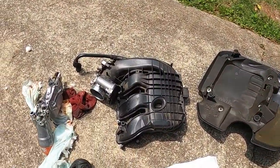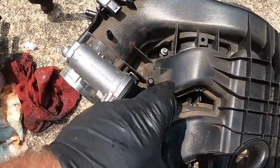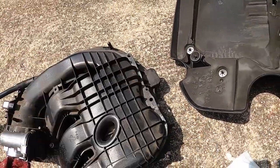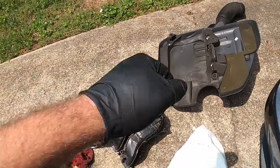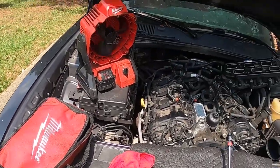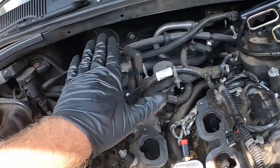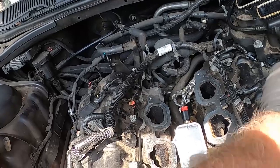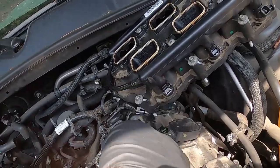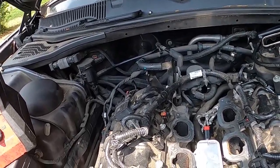You've got your 8mm bolts here, here, here, and here — two brackets, and a bracket back here and one on the side. I usually take the 10mm bolts off and just pry the bracket back so you don't have to take the 15s off on the side. The one back here — just take the two nuts off and the whole intake manifold will slide this way once you have that bracket out of the way.